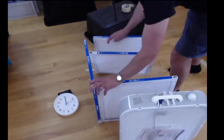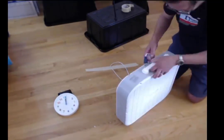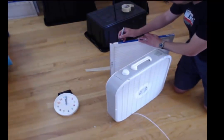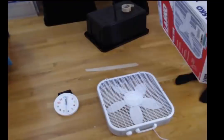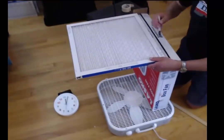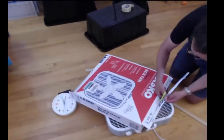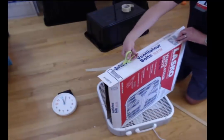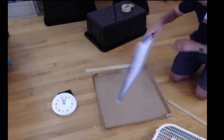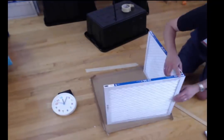I've set the clock and now I'm speeding up the video about 10 times the rate. I took out the box fan and took a look at it to see what direction the air was flowing. I did the same with the filters to make sure everything is lined up so that air comes in through the filters and out through the top where the fan is going to be. I'm going to use the box from the box fan to make the bottom of the Corsi-Rosenthal box as well as part of the shrouding support material.